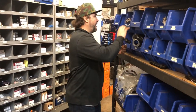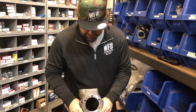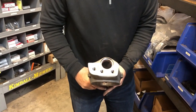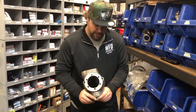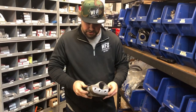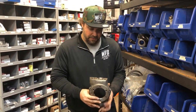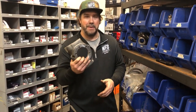Now, if you're definitely going to full high steer, we have the armless Dana 44 knuckles. These have the same flat top, machined, steel bolt-in replacement as far as brakes and spindles — all that. They have dual steering stops threaded into them, but they don't have the factory arm sticking off. So if you're going to run high steer, this is a nice option too.